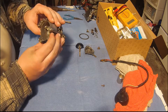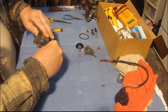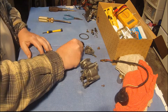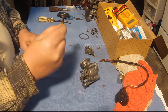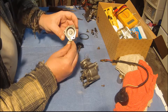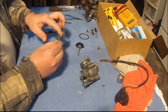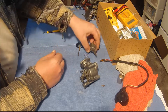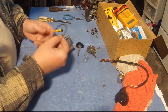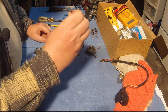I've already cleaned this up — it was full of aluminum oxide and stuff. These sometimes come with rebuild kits and sometimes they don't. Fortunately I do have a brand new one here. You can clean up the spring if it's dirty, and clean this guy up too. There's no fuel going through any of these — it's all just air. If you have a new gasket, might as well replace it. Let me see if I can find a replacement screw for this guy — I think these would do perfect.